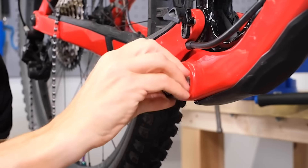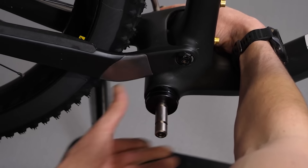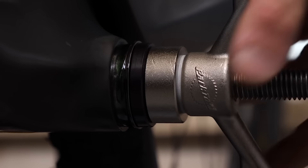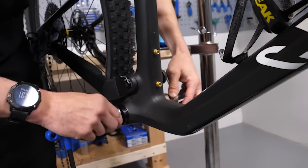I feel like we are moving back to good old-fashioned threaded bottom brackets, and they are good. When you're threading in cups, it's easier to un-thread them versus an interference fit. Old headsets had cups you'd press in, but with a modern external bottom bracket you can't replace the bearings inside — though there are some aftermarket ones you can. External bearings give a bit more space, are a bit bigger, more reliable, and you don't get creakiness if fitted wrong.